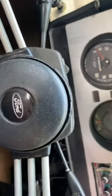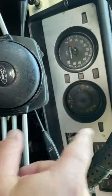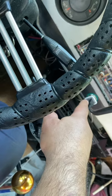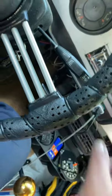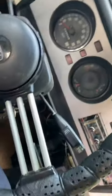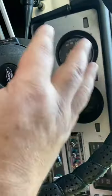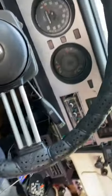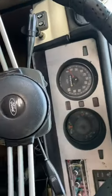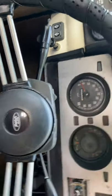So we get home, we pull this cover off. The cigarette lighter is the worst thing to pull off — it always pulls the wires out of the back of it. We get this off of there, we pull the cluster, disassemble, pull the lenses, pull the speedometer, put it into this cluster, put that lens on it, and put it back in. I thought there was something else I wanted to do, but I can't remember what. Oh well, it's not important at the moment.